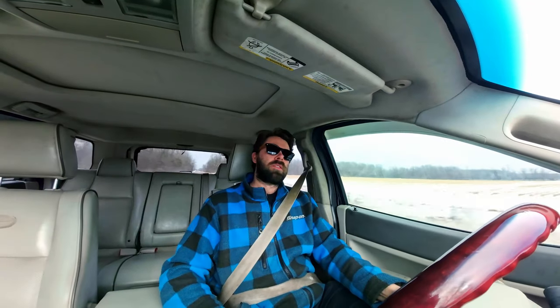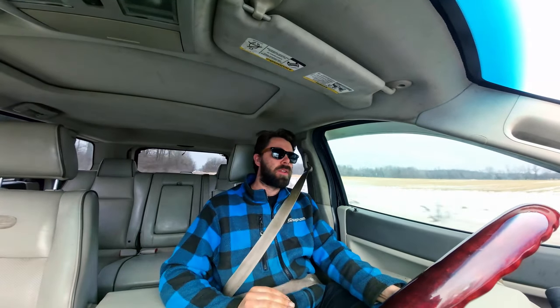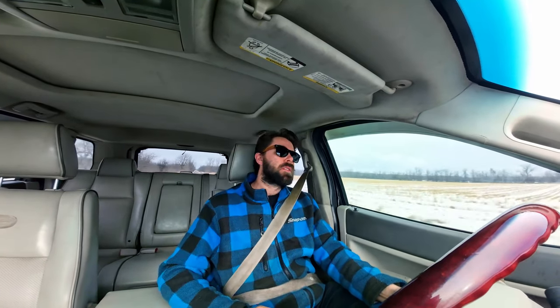Now, some of you might be thinking, a Mercedes diesel, doesn't that sound like a lot of maintenance? The answer to that question is yes and no. This particular OM642 does not have a lot of emissions on it, being that it's in a 2008 Jeep. So that's a bonus. And there's a few little things that I can do to it, like a swirl valve delete. That's about the only other thing that goes wrong with these, other than typical breakdowns, which you're gonna have with any engine. But with that being said, that's where I'm at with this diesel swap.